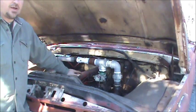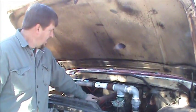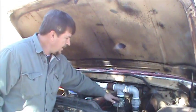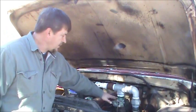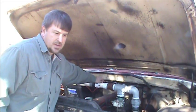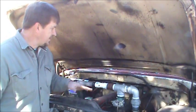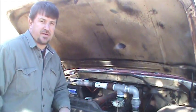This is just an old tired-out six-cylinder Ford 223, about 140 horsepower. The wood gas is brought up as a vapor and mixed with the air. I do have it where I can start it up on gasoline, and I use the throttle in the existing carburetor. But the mixture of air and wood gas I control from inside the cab. It's pretty simple.